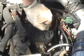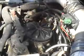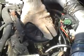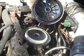They actually make 2 different fuel filters for this vehicle. You can buy the fuel filter with the cap already attached, or without the cap. Because you don't know necessarily what the person before you used, it's always good to buy the filter with the cap, so you can just throw the whole thing away. This one was not the filter and the cap.